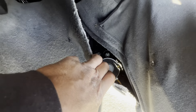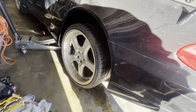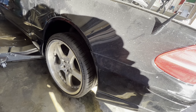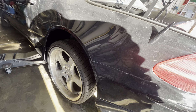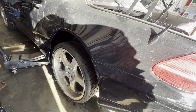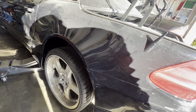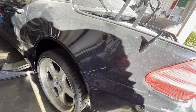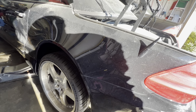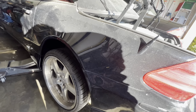To drop this, all you have to do is remove those two top nuts. Disconnect that power line or the plug right there. And, of course, do your removal of everything on the lower control arm. The outer, listen to me, you do not have to disassemble the hub assembly and the brakes in order to remove the strut. You work from the inside, the inner arm. You do the inner lower control arm bolt. It feeds out the rear of the vehicle. You have to lift or drop the exhaust system. Like, just lift it. You can lift it out of the way to totally remove that bolt.